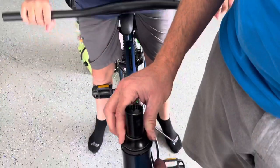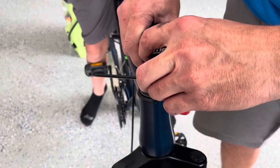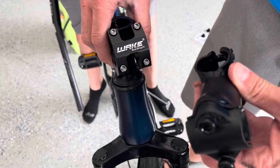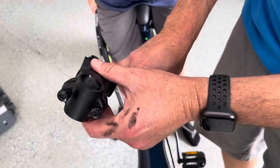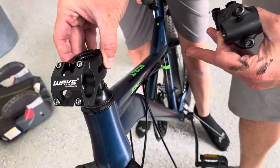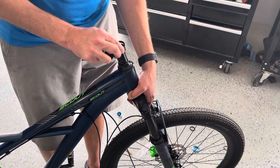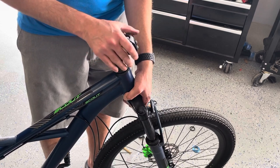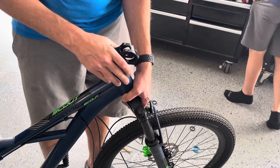Let's get the new stem. We're going to need a spacer on the stem. If you see here, the size is different on the stems — see how much wider this one is? So when I put this one on, we can either do spacers right here or on top. I think we're going to lift this up a little bit, so we're going to put spacers right there. We're using these two — there's no sizing on the spacers themselves — but we're using those two. So if you buy this same kind of setup, you'll need some spacers. We want them on the bottom, basically right at or slightly below where the stem sits.